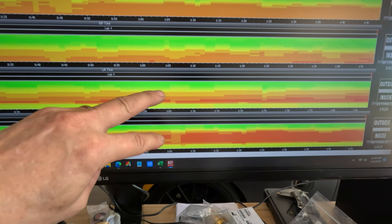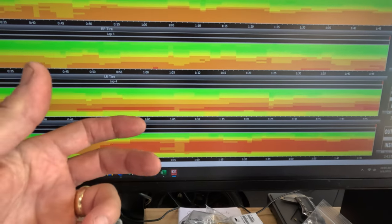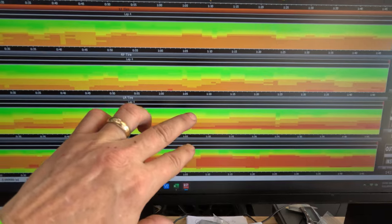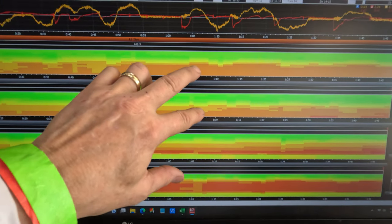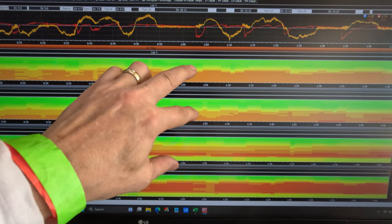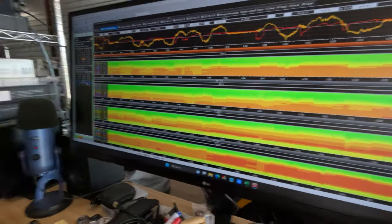This also allows you to look at your pressures as well, right? Because if you have too much pressure, the inside of the tire would be hotter than the outsides, that type of thing. But you can see here how the heat signature moved, and the fronts were more pronounced even than the rear. Now, we just ran, it drove great, but based on that, we actually took a little bit more negative camber out of the front moments ago, and we're going to go back out on track and see what it does. But I just wanted to show that to you. I think you might find that of interest.